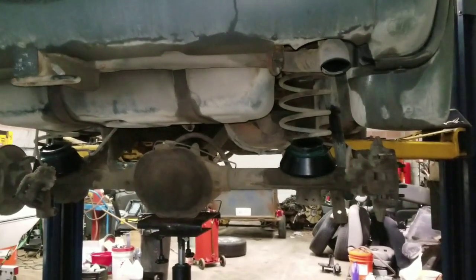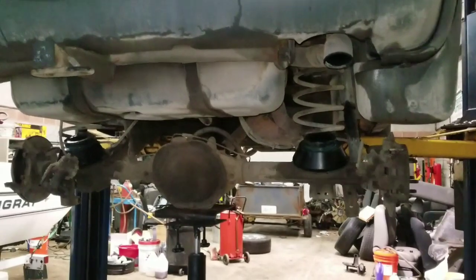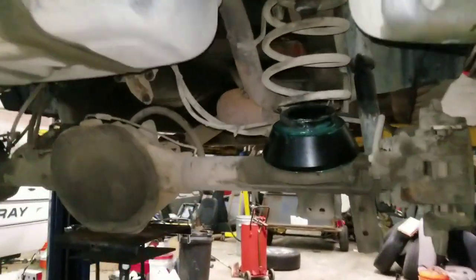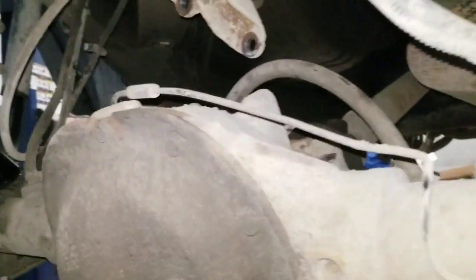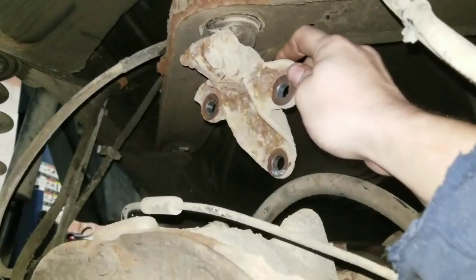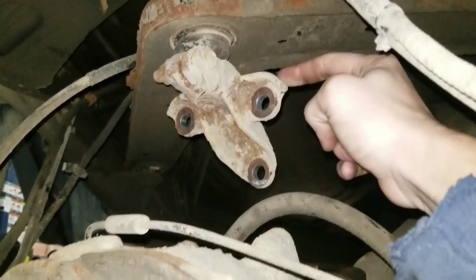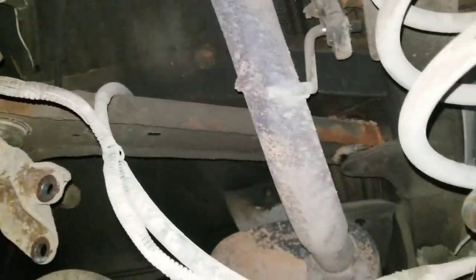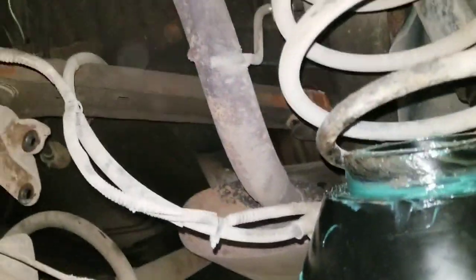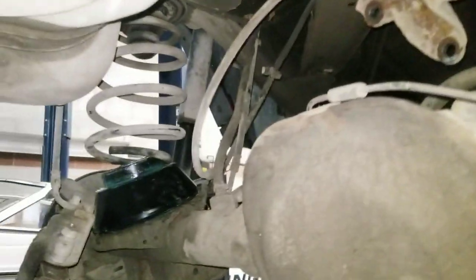So it appears our dickery has started at the back of the Jeep. And of course, no videotaping until after we're basically done, just like always. So on this wishbone here for the back of the diff, they suggest taking it apart here. I say nay, take it apart here. It allows you to drop your diff that much farther. And then don't forget to disconnect your rear shocks to give you some extra dangle clearance.